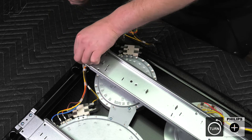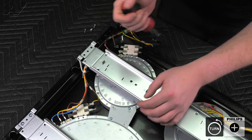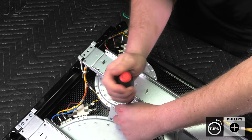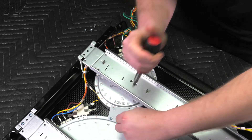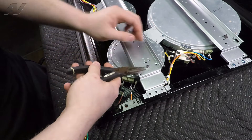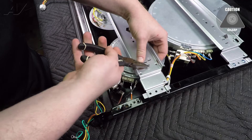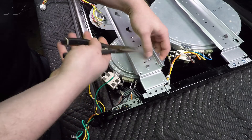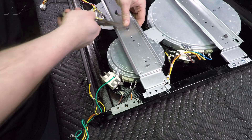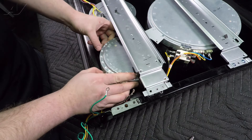It should pop up. Move your strain reliever. Next, remove the screw that is holding on the bracket on the back. Now that you have this done, press in on these tabs with a pair of pliers and feed that down. Do the same with the other side — press down and you can slide out your element.